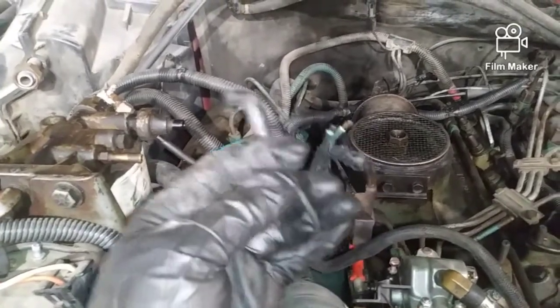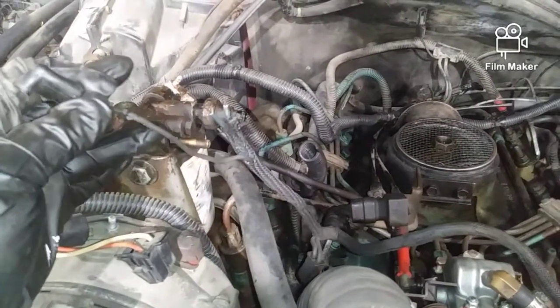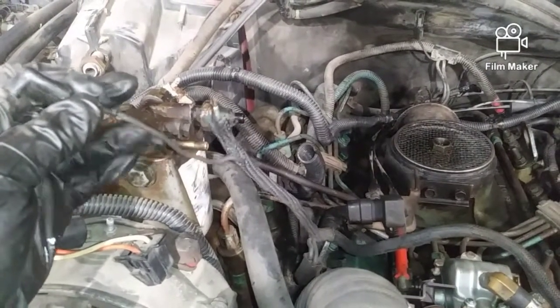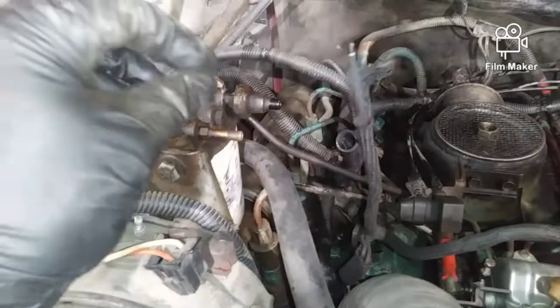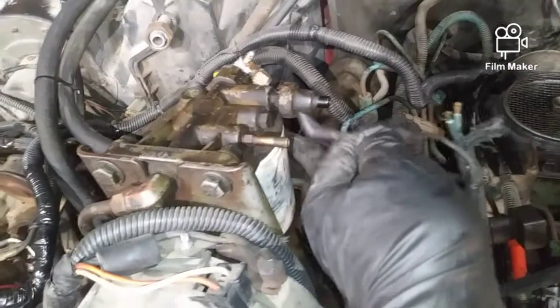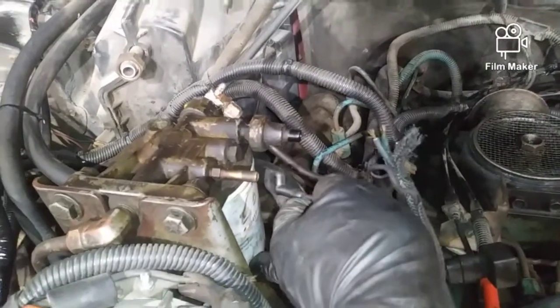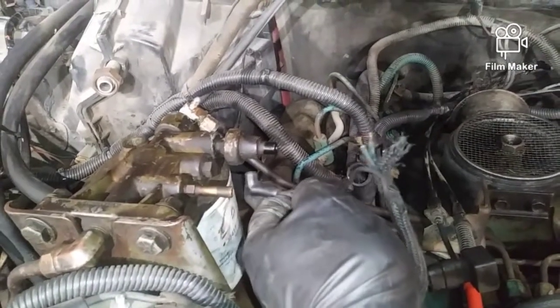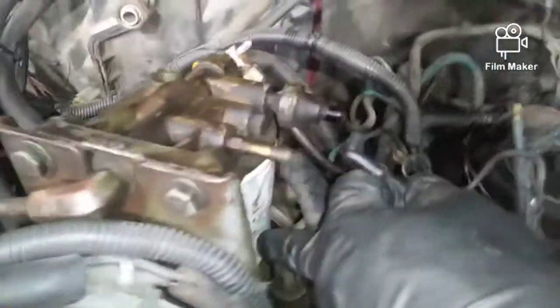If I had used my common sense, there is a light bulb upstream toward the positive, and that light bulb you want to check and make sure it's good. And it's looking for negative, negative, negative. When this goes down, the whole thing's negative: chassis, engine, everything, even the fuel filter is negative. It's chassis, okay, it's ground. And then since the water is conductive, that sensor can only complete the circuit and illuminate your light in there that says there's water in fuel if the conductor, water, gets in the bottom of this.